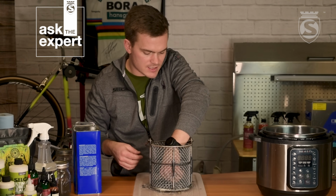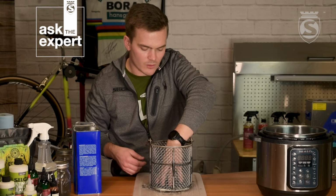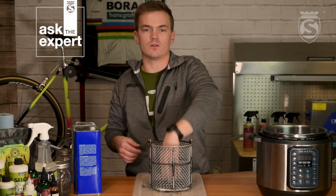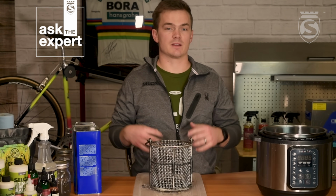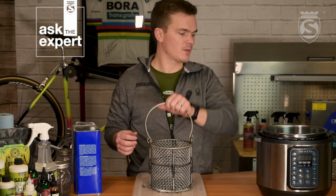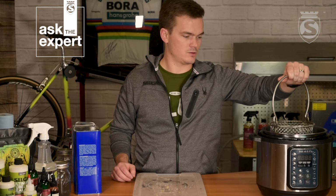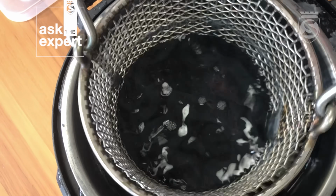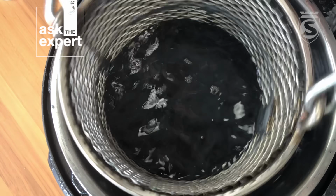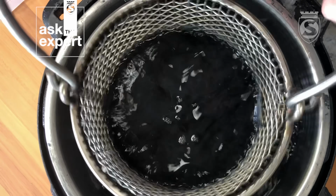And really what that does is it leaves as much wax in there as possible. If you take it out and the wax is really hot, it allows some of it to run out. You don't need to go crazy with this, but the closer you get it to there, the better it's going to be. So we're just going to take our little pot, drop it in, and give it a little shake. And that's going to help drive some of that wax into the small nooks and crannies in between the pins, or in between the plates, which is really what you're trying to get lubricated anyway.